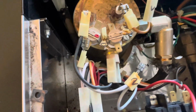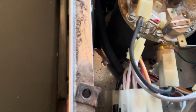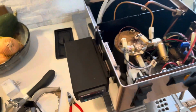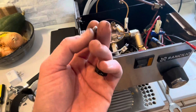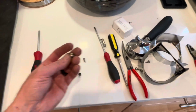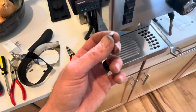Okay, while this is open, I'm gonna go ahead and get the cowl installed. You can see down here where my finger kind of is coming through in the light. That's where on the top, you're gonna put one of these face down, and it's gonna pinch coming up from the bottom with this screw. Now, the set that I ordered did not come with the screws, although it did come with these nuts. So be sure to save these screws from your old pieces. And you should just be able to screw those in hand tight, and that should hold.